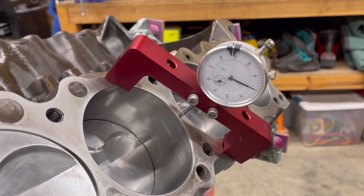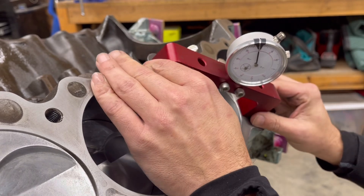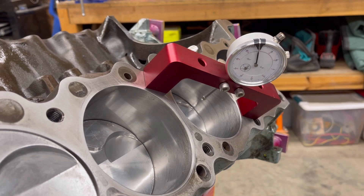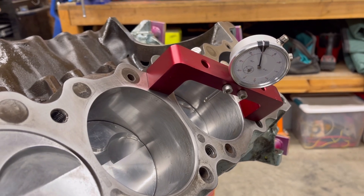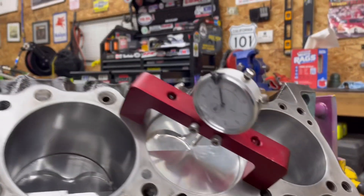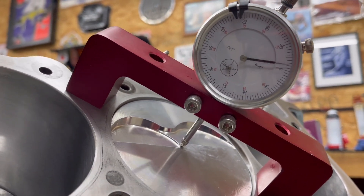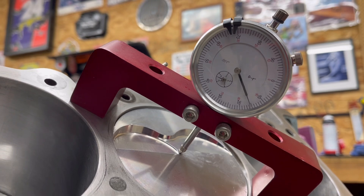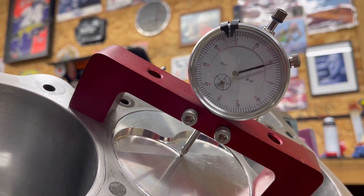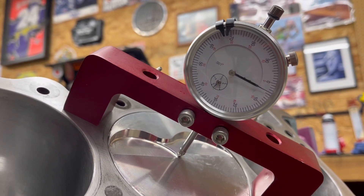So the next step, I'm going to place this over the center of the piston and get that in place. Make sure that's clean. Kyle is going to turn the engine over, and what we're doing is also finding top dead center. He's going to go around, and when it reaches the peak we keep watching — he's coming up, going to a point, then going back just a little bit to get our absolute spot on that.